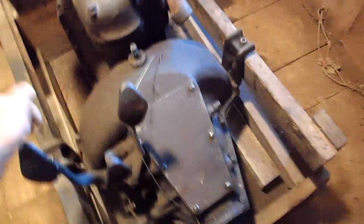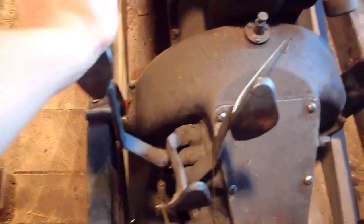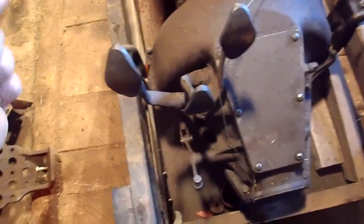I also want to explain the T transmission. When you're driving off, you have a pedal here and it rolls on this little cam. You pull the pedal back, it puts the high-and-low pedal in neutral. You let the pedal out and it enables it to go into low. Then you're pushing on it and you let the other control lever all the way out, and that enables it to go back into direct, which is high gear. This right here is your reverse - you put the control lever to go into reverse, this pedal's in the neutral position, and then you can push reverse. And this is your brake, which is a brake inside the transmission too.